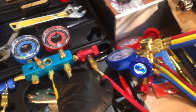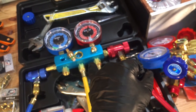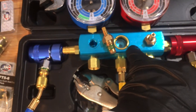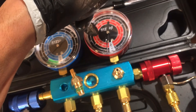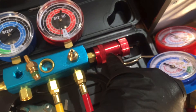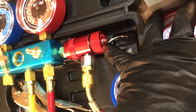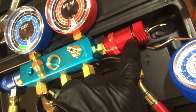If they don't hold overnight and pressure comes down quite a bit, I'll put them under a vacuum, fill them with a little refrigerant vapor, then back-feed with maybe 200 psi of dry nitrogen into the gauges. Then I'll take a leak detector and go around the side glass — sometimes they leak around the side glass because there's an o-ring there. I'll take the plastic off and leak check inside the gauges. It can actually leak up the shaft and out where you screw the gauge down, so I'll pop off the back sticker, take the screw out, find the snap ring to remove it.